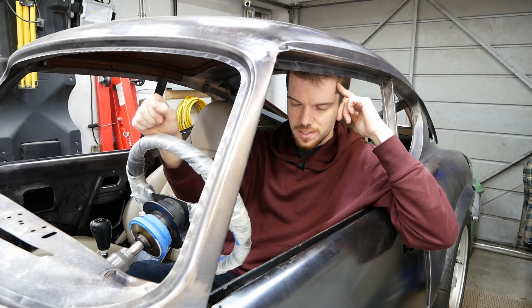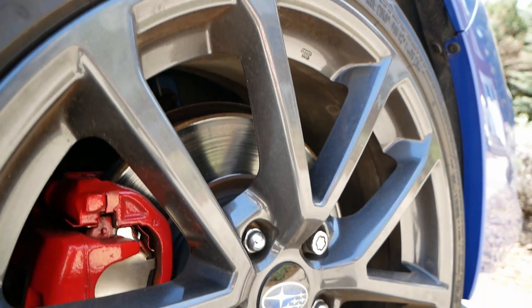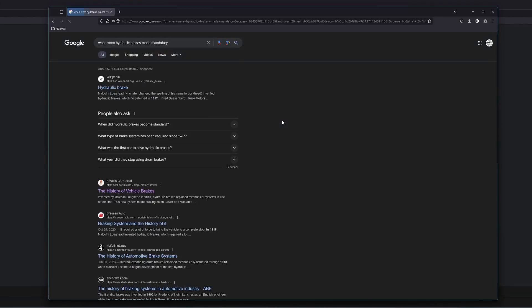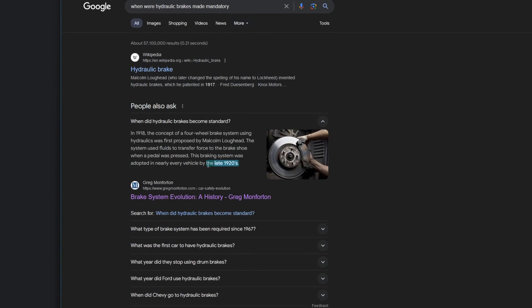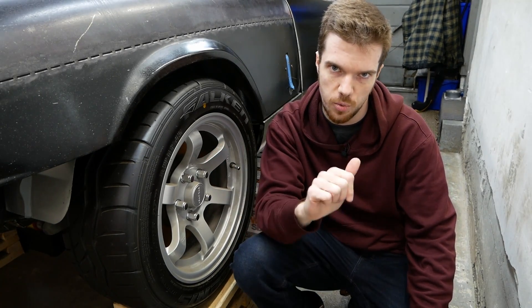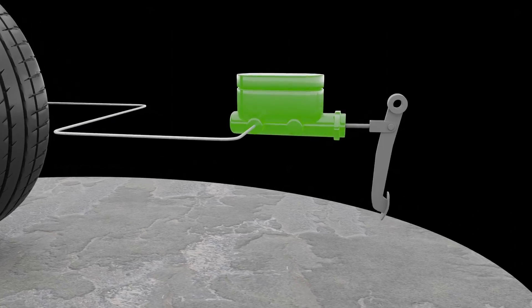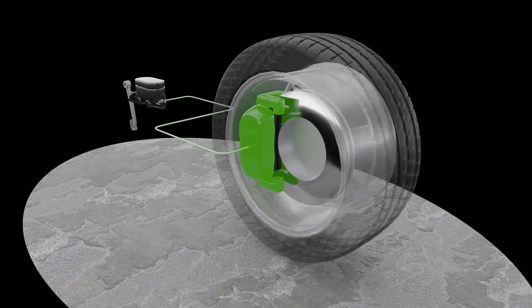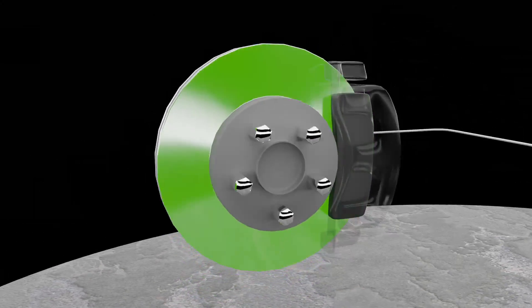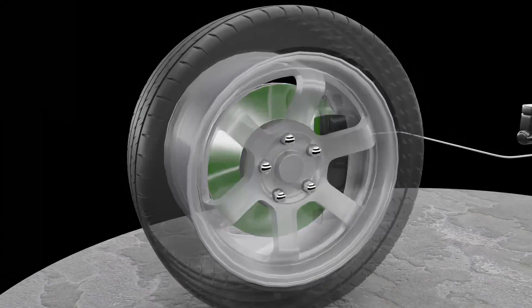This is by far the most complicated system, but also the most interesting. At the core, brakes inhibit motion by absorbing energy. And since the late 1920s, nearly all passenger cars have used hydraulic brakes in two flavors: discs and drums. Drum brakes are still used by some manufacturers today, but the disc is what we'll focus on. In this setup, the master cylinder pushes fluid out to four calipers, which each have one or more pistons that extend and force pads up against the discs, also called rotors.